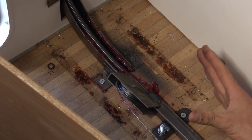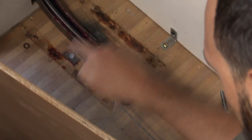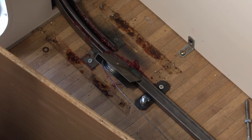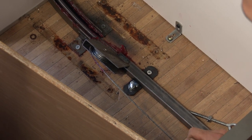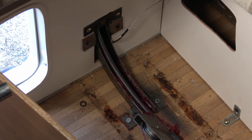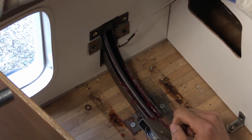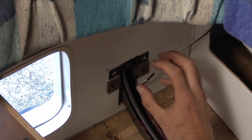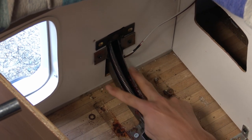This setup in this corner is exactly the same in all four corners of the camper trailer. To remove these, you'll find a singular bolt with a nut and some timber screws — take them all out. It'll loosen up your drive tube. There's also a screw at the other end of this tube. You have your old eye bolt; if you want to, you can cut that off with some bolt cutters. Really important: on this corner guide, you'll be removing these open corner guides and putting in the Jackajay fully enclosed tube corner guides. To remove this guide, there are two screws on the bottom and two screws on the sidewall of your camper. Very important: do not remove the screws for this upper bracket — this is the support for your telescopic mast. Do not remove these four screws, only these two here and everything downwards.